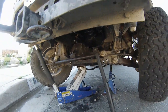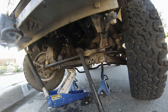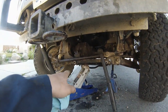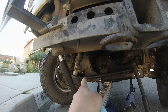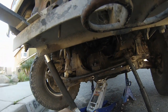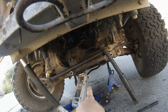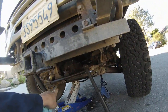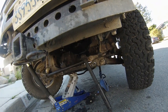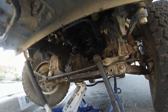I wanted to let everybody know that my differential did not drop all the way. I've heard everybody say, 'oh yeah, you can drop that diff,' but you guys are bullshitters. You have to drop that front crossmember to get that diff to even move. The diff mount on the passenger's side hits the frame. When you lower it, it'll get to a point where it just knocks into the frame — it won't go any lower. My truck's been tweaked somehow, and that bottom crossmember does not want to come off. There are no bolts in it because it's not bolted in — it's tweaked inside there and it won't come out. So I couldn't lower it any further.